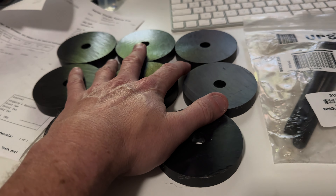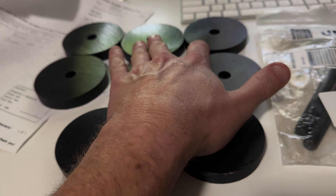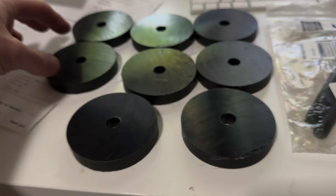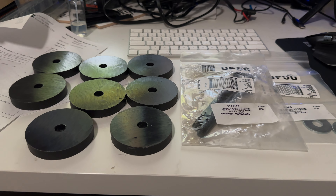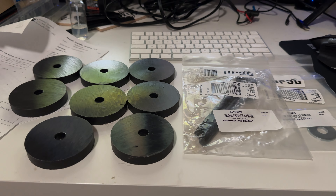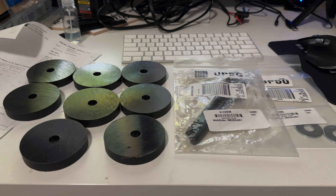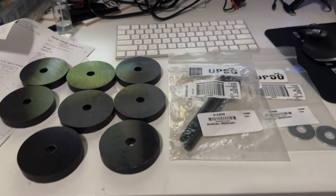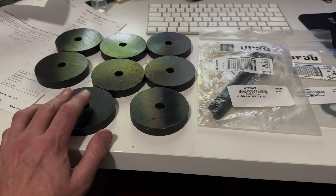Just for those front two mounting spots — if not, we'll use the stock bolts. You need eight pucks total: two for the very front, two right behind the front doors, two right behind the rear doors, and two in the very back. I'll put some links below to other installs with Brock Buster and other guys to give you an idea of what's involved. I'll try to shoot some footage of mine as well. Personally, I want just a hair more lift — the highest I'd consider would be one inch — and I'm starting with the half-inch.